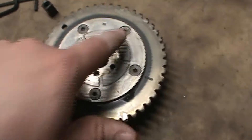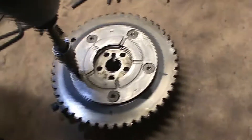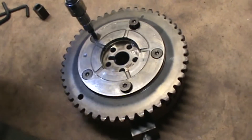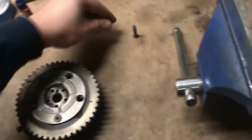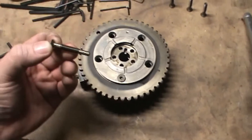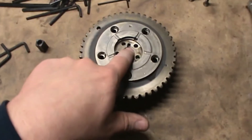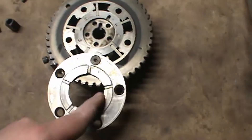So then you're going to remove these other four bolts. For sake of speed, I've already pre-loosened them off camera. I do recommend doing this by hand — I loosened all of these by hand before I started recording. I'm going to take these out and turn them upside down in the order that I take them out, because this one on the far left is different. We're going to keep that keyway facing up and lay out the bolts in order. Now you're able to rotate this out of the way.